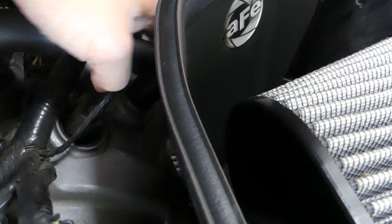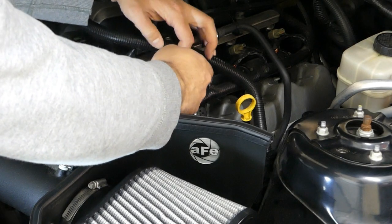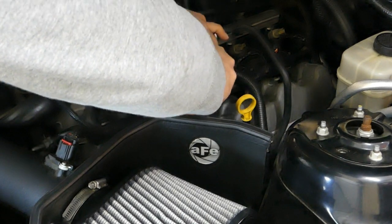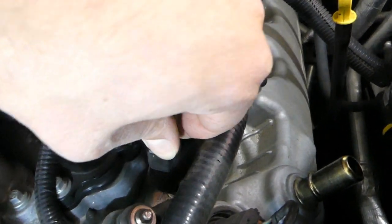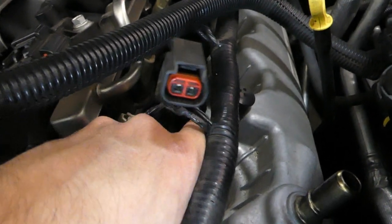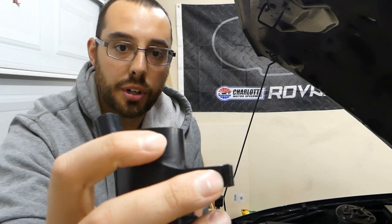I'm going to remove the PCV hose so that you can see better what I'm about to do. The bolt is taken out — we're doing this bank right here. There's an electrical connector that you're going to have to undo. It's just a push, it pops right off. And then once that's free and the bolt's out, just take the coil-on plug out — makes a little popping sound usually. And there it is. This is the coil-on plug once you've removed it. This is the main electrical portion where the harness plugs in. And down here, this is what sits over the spark plug when it's installed.